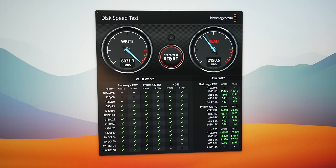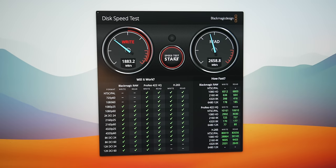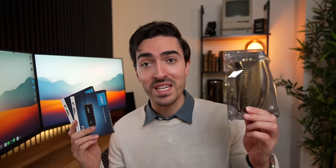When we run a disk speed test, Apple's internal SSD is the fastest at five or six gigabytes per second. For an external SSD, this Thunderbolt enclosure does 2.5 gigabytes per second read/write, which is very impressive. But I do have a Mac Pro, which means I can install two four-terabyte NVMe SSDs in a PCIe riser card. That should allow us to create an eight-terabyte ultra-fast PCIe RAID array of SSDs — and this is the only Apple Silicon device that will let you do that.